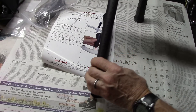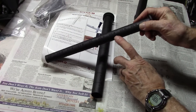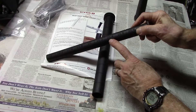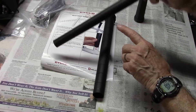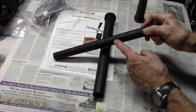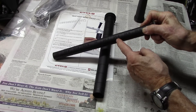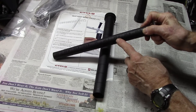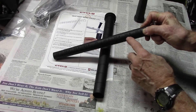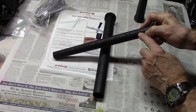The way these are put together — let's look at the 25.4, which we knew was too small. When we insert this into the seat tube, the bottom of the 25.4 is about 25.3 and the top is 25.5, so if we insert this and it goes to the middle, it's 25.4. Remember that the seat post sizes vary in 0.2 millimeter increments: 25.2, 25.4, 25.6, 25.8, etc.